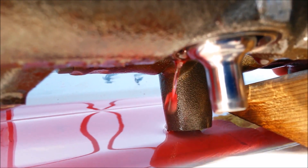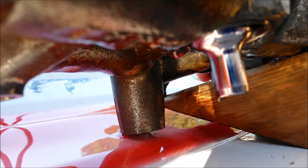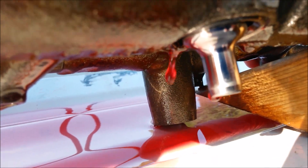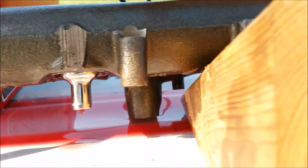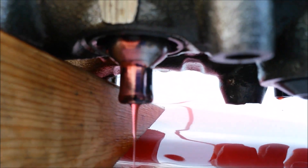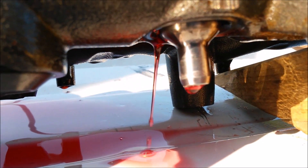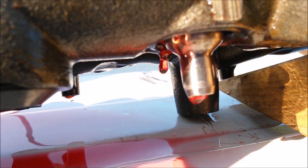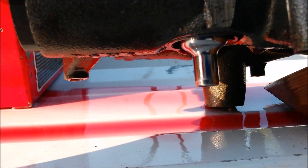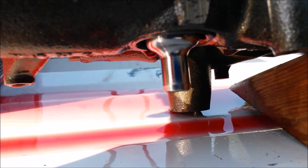See how the oil is just being deflected away from the body of the nipple cup? It's actually being deflected up into the oil rail, and then it's traveled along the oil rail off. OEM, you can see it's coating the entire thing. Same thing with the aftermarket — it just travels along the body of the nipple cup and hits your top injector seal. Whereas ours, it just gets deflected harmlessly away.